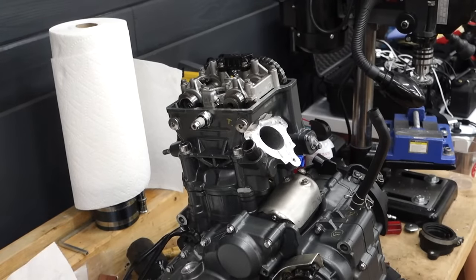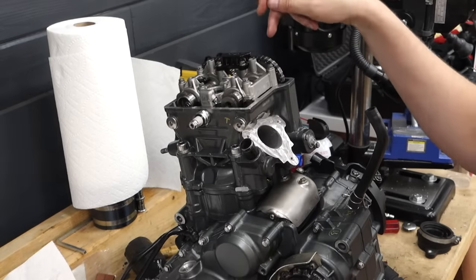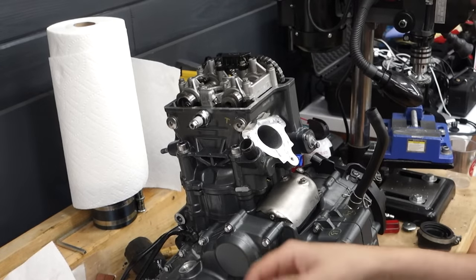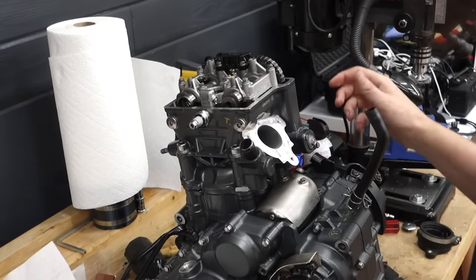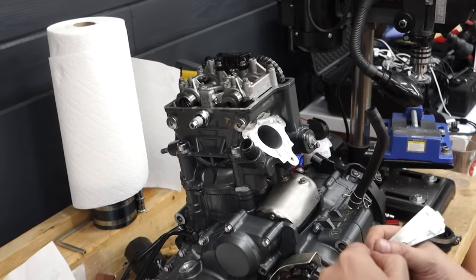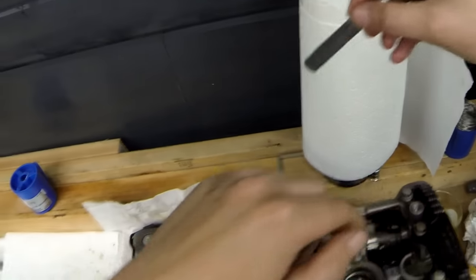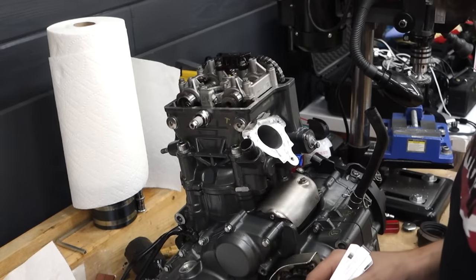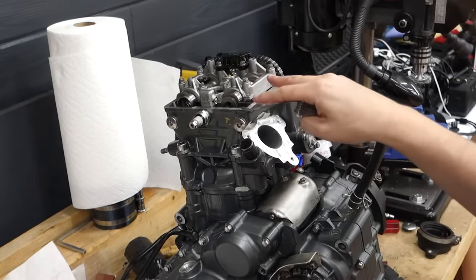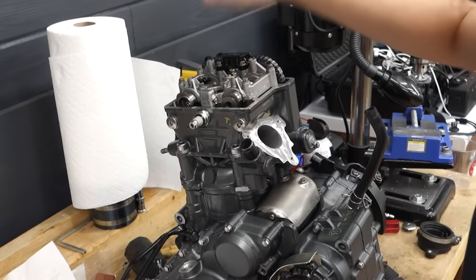I got everything back together and turned the engine over a couple times. I'm going to triple-check my measurements, but everything is in spec. I had to do this twice because the intake in the back was still too loose, so I ended up with a 2.35 shim in there. Everything is re-torqued, got the tensioner in. The exhaust valves are now set to 0.14 - yeah, that just grabs, so those are perfect, not too tight and not too loose. The intakes are set to 0.11. Both intakes at 0.11, both exhausts at 0.14. Now we can slap everything back together.